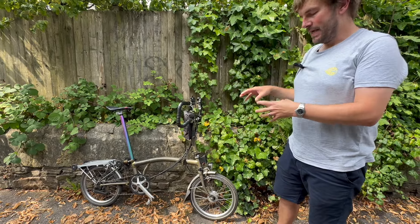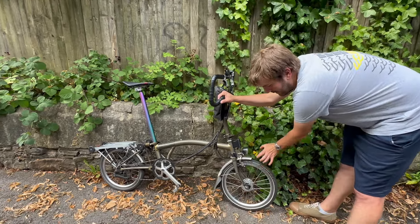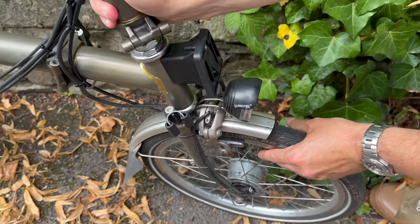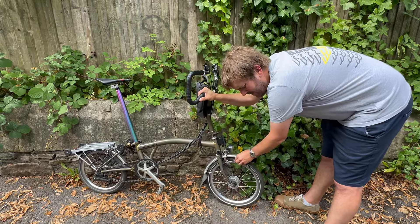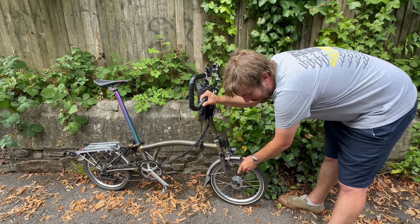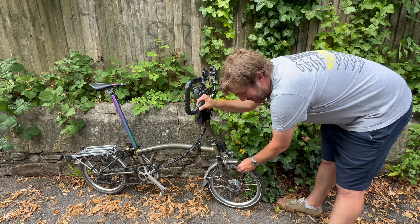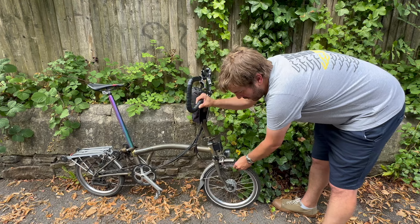You want to go around the bike and see if there's any play in those parts. It's not the end of the world if there is, but there's going to be a bit of money you're going to have to spend to correct that. As you grab the bike and move the wheel in this direction, there should be no play — sometimes they'll hit against the brake pads, but there should be no play in that direction. To be honest, there is a little bit of play in my front one, so that needs a bit of addressing. A little tighten up with the cones, a bit of a loosen, a bit of grease here and there will sort that out. As a job, it's about £20–25.